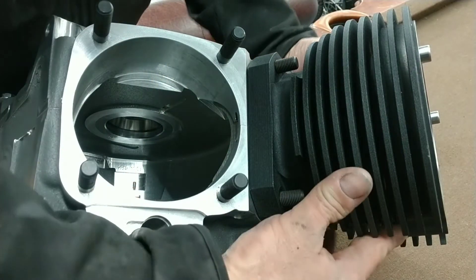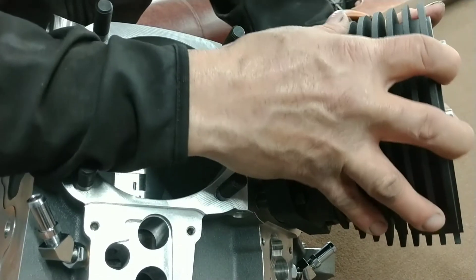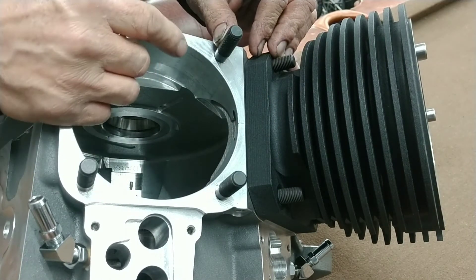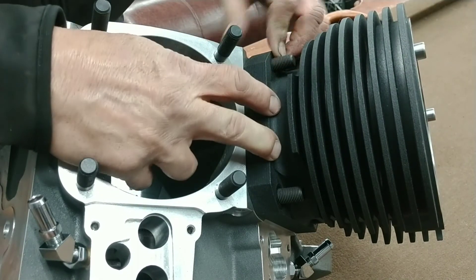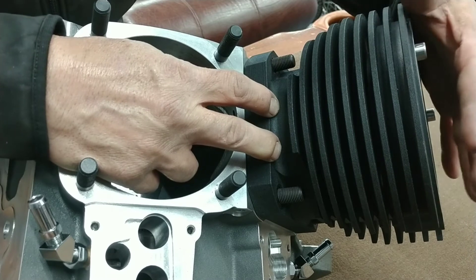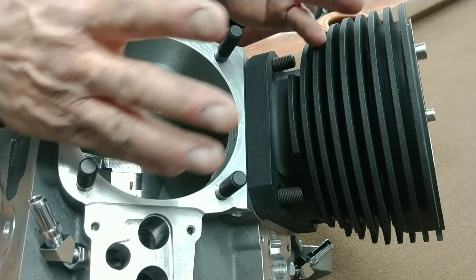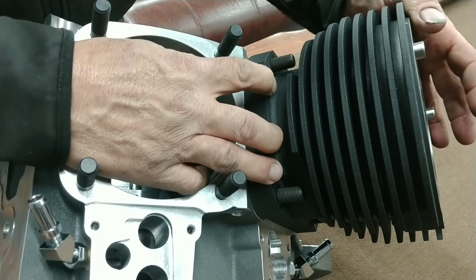One of the key features about running steel cylinders like this one is that it's real nice and snug, and you run studs and bolt it down directly to your engine case, compared to the long studs in a regular Twin Cam or Evolution. The cylinder gets bolted down to the case and the head gets bolted down to the top of the cylinder. That keeps it centered to the bore and keeps it from moving or walking around, compared to cases with long studs which have more opportunity to move back and forth and aren't as tight and square.